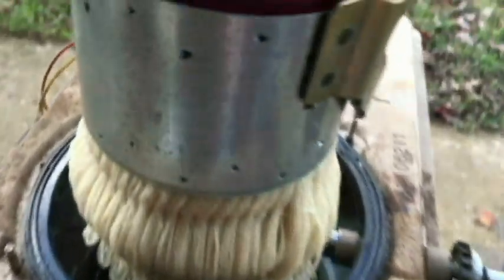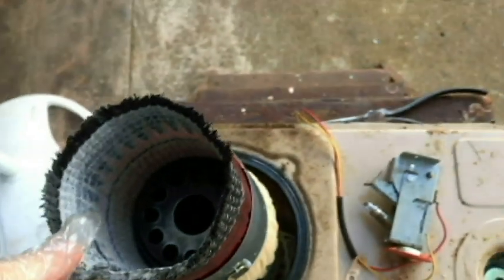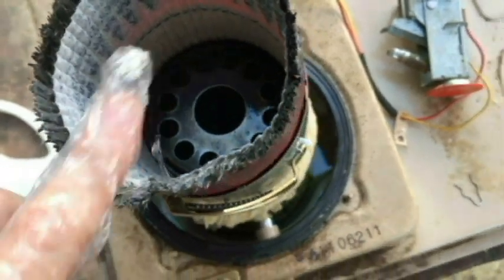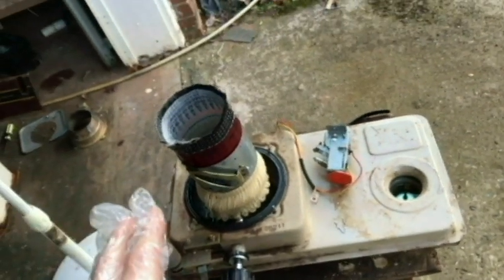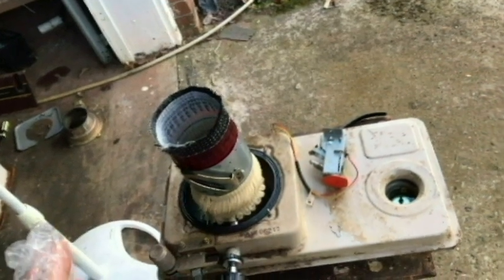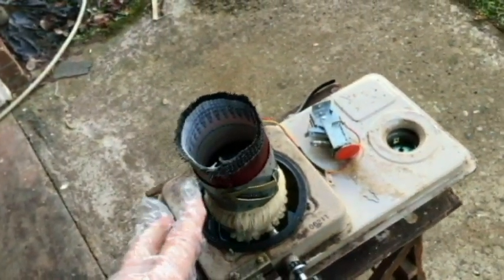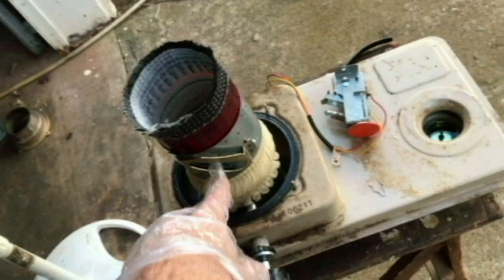So the next day — I've got an update. I went ahead and put the wick holder at the B mark and tried to line it up there the best I could. Before, we had it at A, and I just didn't like the way it was looking there — it wasn't coming above the burner or the cylinder. It was just like the old wick. I have no idea how the old one was used. So we're at B here, I think that's going to be better. I can always turn it down — I've got plenty of room to turn it down.